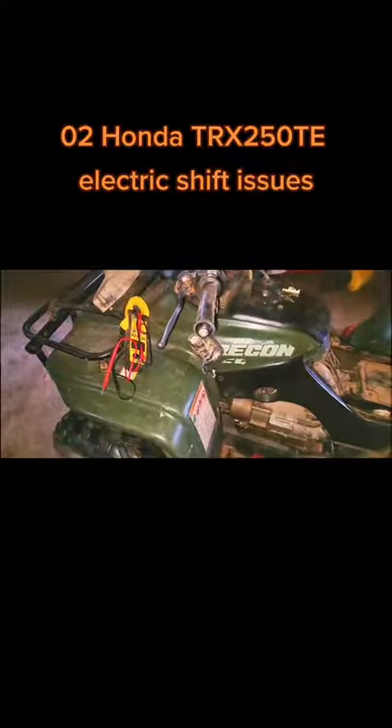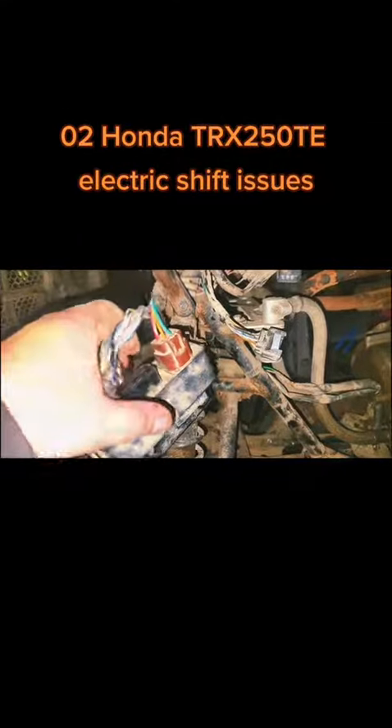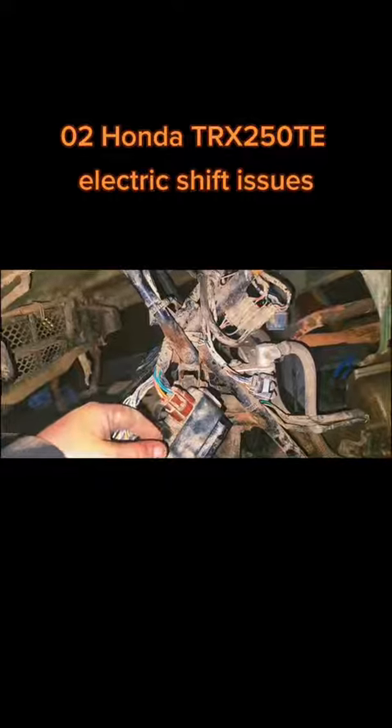I went to the buttons, brought out the wires, checked the red wire for continuity — did not get continuity to the ECU. I found out that the harness to the buttons seems to be good, but the main harness from the button plug to the ECU plug has a break in the black and red wire, which is your ground. So we've got a break in the ground wire in the main harness — that sucks.